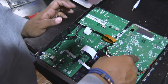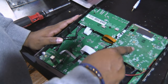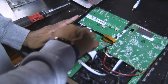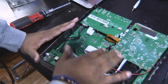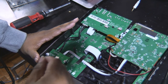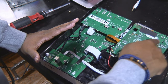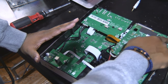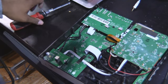I have to grab on this piece because I loosened it up last time. This is also where your power supply is. I want to say the hard drive is in here too. This is your audio inputs and stuff right here. You're looking at all these ribbons and wires — don't let it intimidate you. First thing: you do not disconnect any of these wires, ribbons, or anything like that. What you will need to do is unscrew these screws right here — not these, these ones up here.